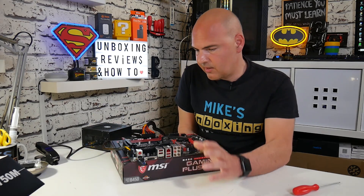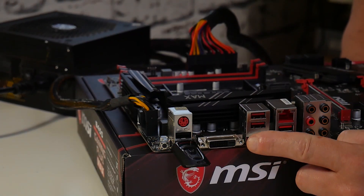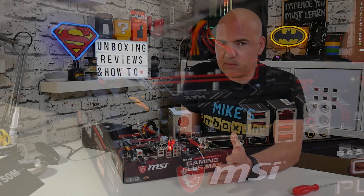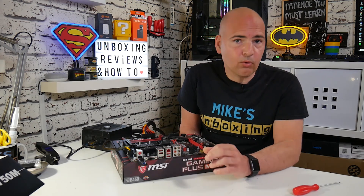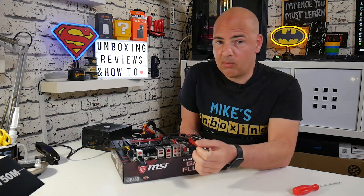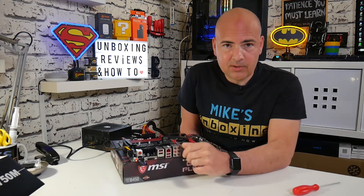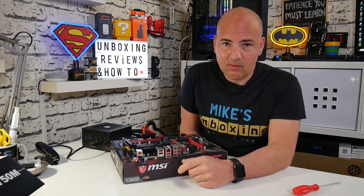Sometimes there's a little bit of a delay before it starts. You will notice that the power supply fan will spin up, and you should hopefully see that the USB stick — if it has a LED — will start flashing as well as the BIOS flashback LED. The BIOS flashback LED also has some error correction in it. If there is a problem, maybe your drive isn't formatted properly or the BIOS file is in the wrong format, you will get a kind of error code readout. If your BIOS light flashes twice and then stops, you've probably done something wrong or your USB stick isn't compatible. As you can see, the light is flashing away quite happily, so all we need to do is have a quick cup of tea and wait till it stops flashing.